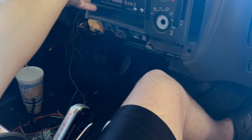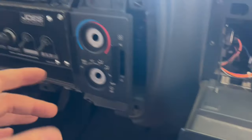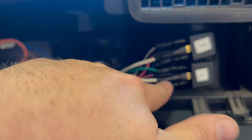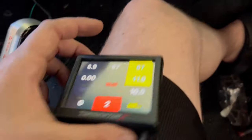I can change plugs and do whatever I need with that light. If my schematics are correct the truck should fire up, so let's try. Ignition should run the fuel pump — and it does not. How about now? Oh yeah. I had this wire and this wire switched, which was something I was afraid of. Let's see if it starts.